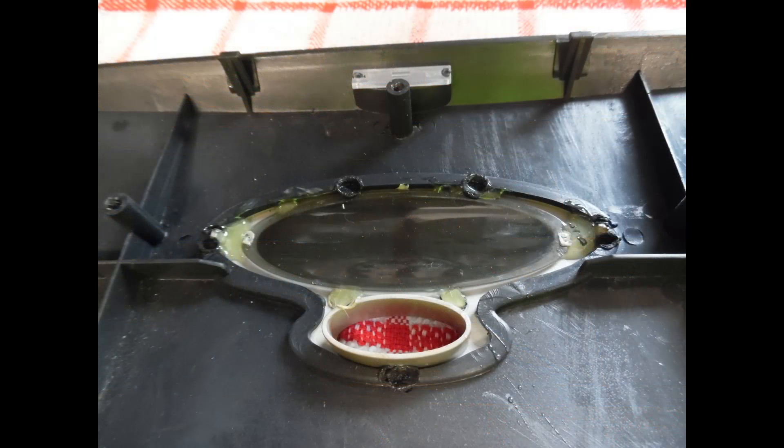I'm now showing the bezel repair. I just clean that off and make sure the filter can sit very flush with no residual plastic. Then I use a two-part epoxy resin — in this case Araldite Rapid, which sets in about five minutes. Just be a little careful, because when you mix this stuff if it's warm in your workshop it can trail across the screen or filters. Apply some left, right, top and bottom, give it 10 or 15 minutes, and when you come back it'll be better than new.